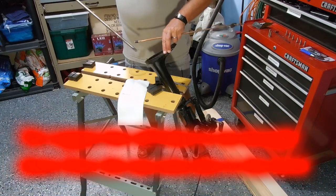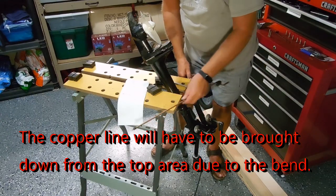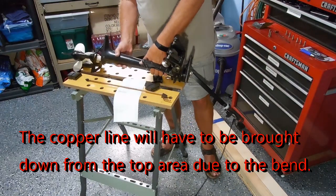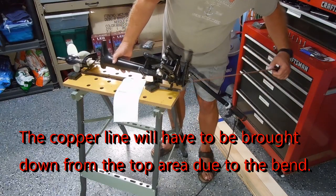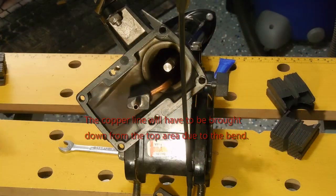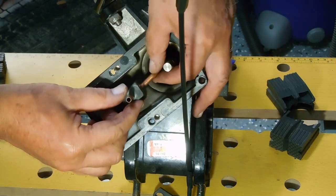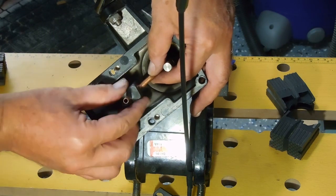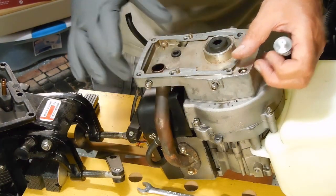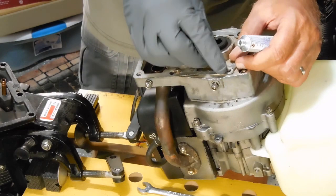Here's everything back in position — here's the copper line and how it's going to come up and over, putting it in the proper position down at the water pump. This is where I broke the gasket, but this isn't anything to do with an internal engine component, so I'm just going to take a little of this gasket maker material and apply it.